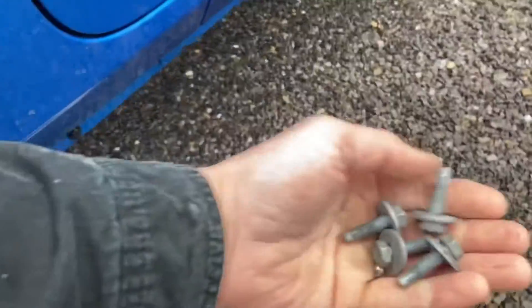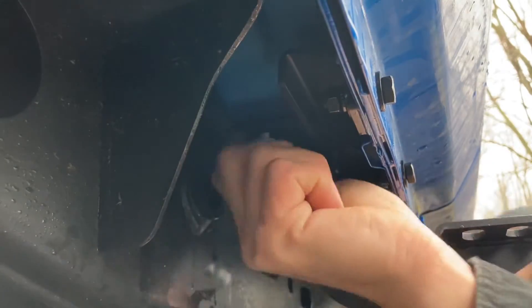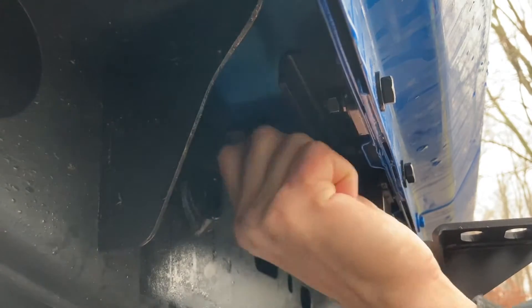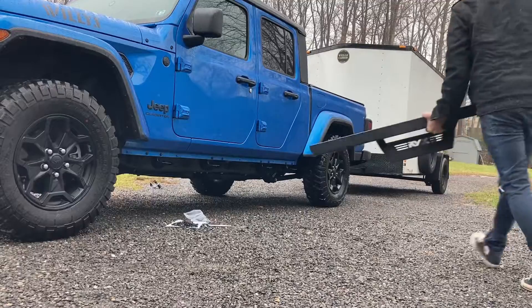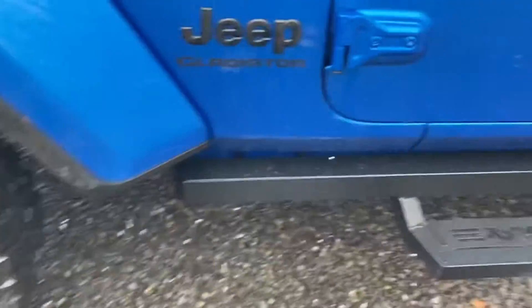Got the brackets on on the driver's side. Now I'm going to take the bolts that came from the stock equipment and they're going to go up into the body — just going to get them finger tight. I got a lot of the stuff tightened up now, got it lined up. But what I found was that this bracket right here by the driver's side door was actually stamped wrong, so none of the holes would line up underneath on the brackets. I had to swap out a bracket from the other side and bring it over and put it on, and once I did that everything lined up. So I'm just in the process of tightening everything down now.